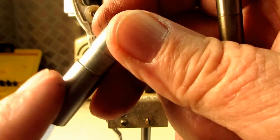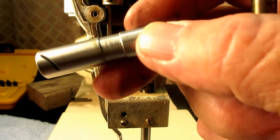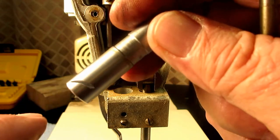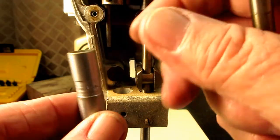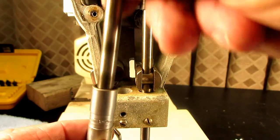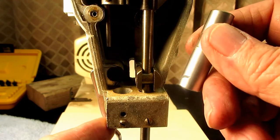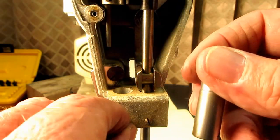I'll be able to give that a good cleaning now that it's out. That's where the spring goes, and the extension pin went in the top of that — and that all sits through the guide bracket that the lever lifts. Let's look at this bushing. The presser bar that's been sitting in there — you can see where the bracket was, it's clean and shiny, and the rest is dirty. The inside of that bushing will be the same way, so instead of just putting oil I'll be able to clean it out with a brush and crud cutter. There's the little indentation spot for the set screw — that's why you loosen that set screw more than just one turn to get it past this flat spot. And here's the thread cutter on the bushing — this is the presser bar bushing that the presser bar slides up and down in. When we put that back, the thread cutter must face to the back.